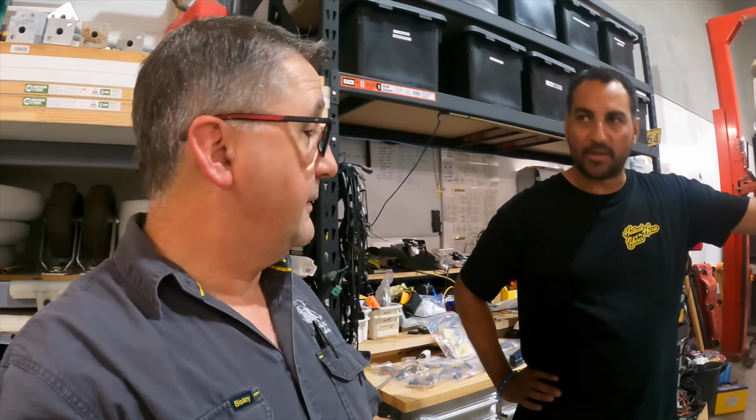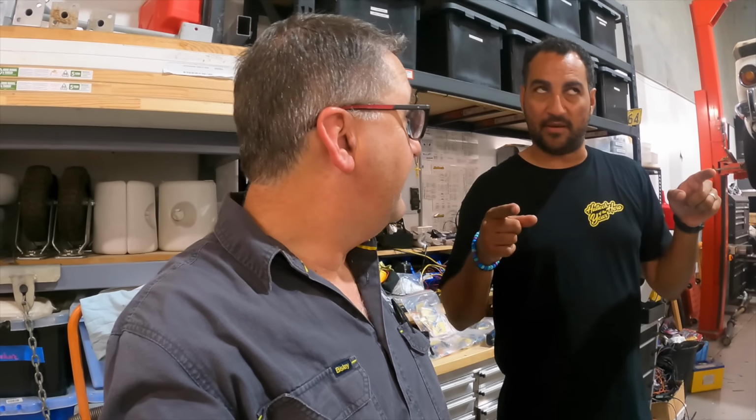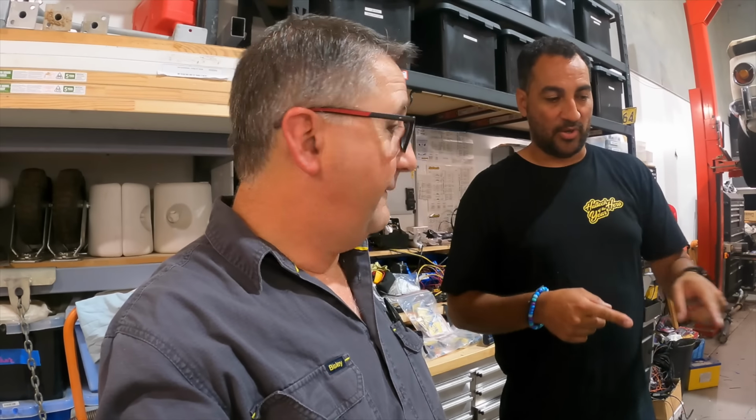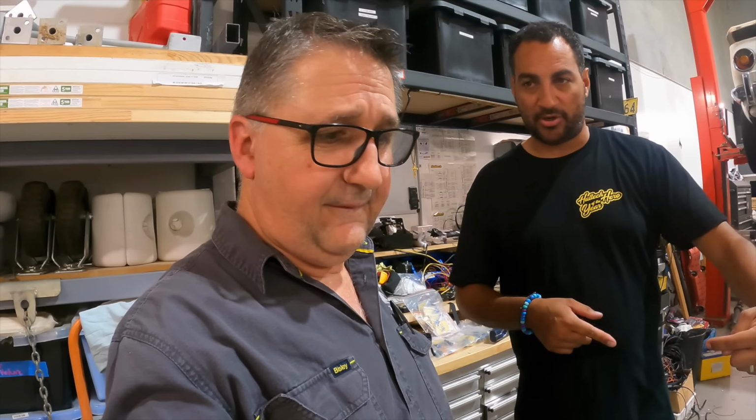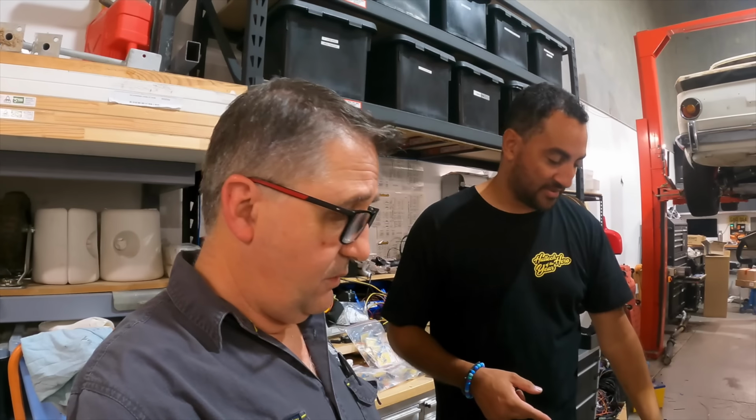The old air conditioning, when you turned it on, had a little electric switch that turned on a vacuum line that pulled a diaphragm that cracked the throttle a little bit. So what we're going to do with this one is do it electronically. I've run some wires and intercepted the aircon compressor. As the car wants to turn it on, I'm going to steal that signal and put it into an input, and we've run it over to the ECU.